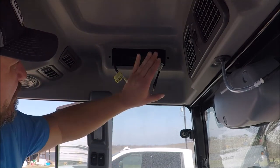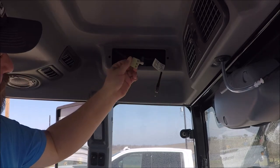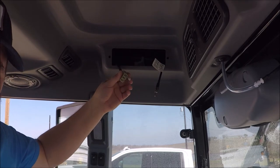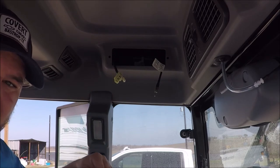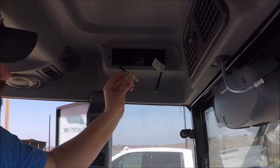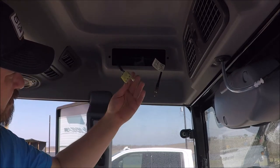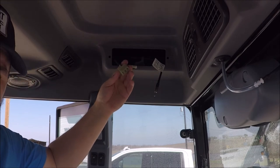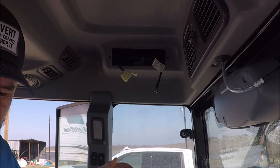So I've got the front panel off. If you reach your hand in there, you're going to find the antenna hookup, the hookup for the tractor, your left and right speaker wires, and then your positive and negative for power. Again in the video description I'll put down what color the wires are and what they mean. So basically I printed it out — the pink wire is the hot wire, and then black, brown, all the basic wiring. I'll put that in the description so you can print it out if you need it.